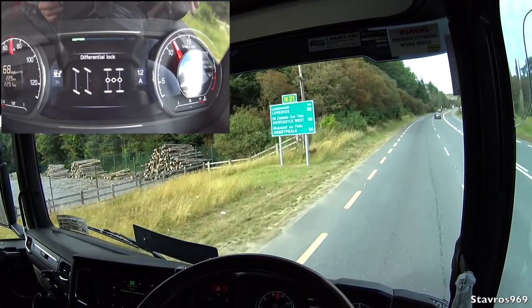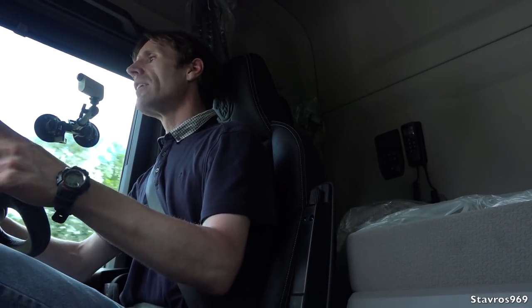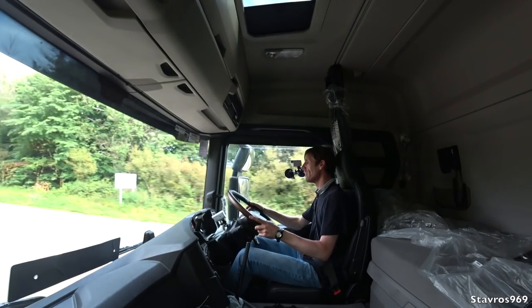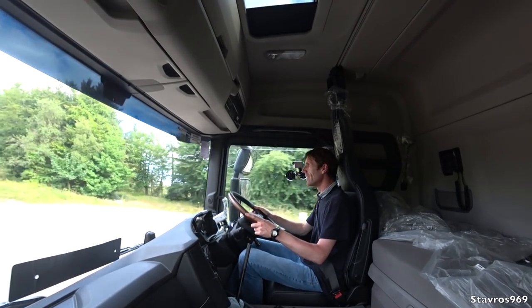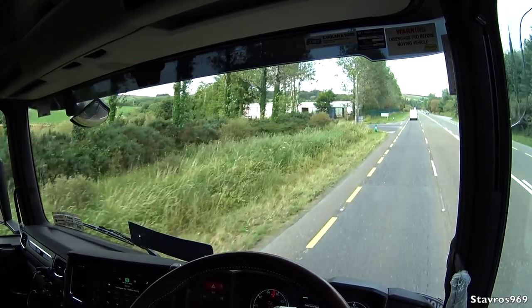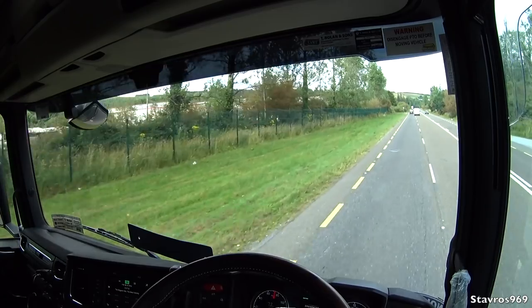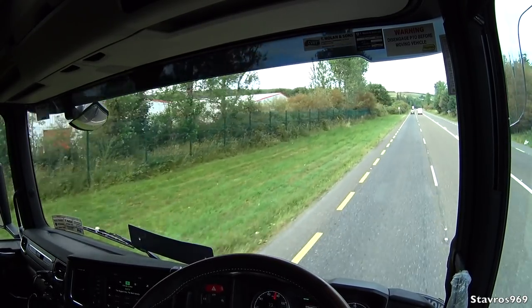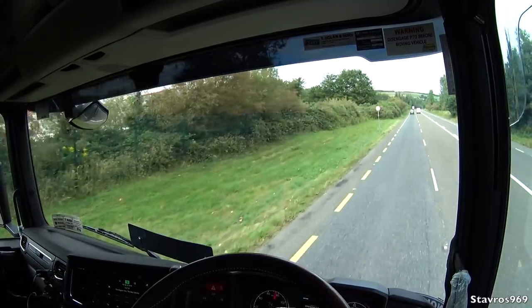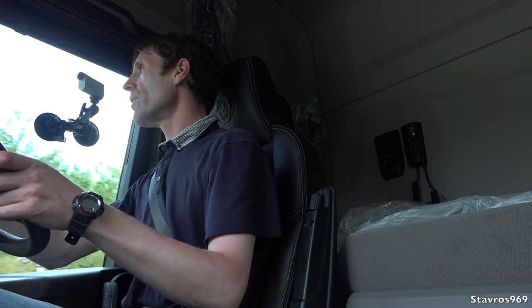Now I do have manual control. I can manual down through my gearbox, press in the clutch, go down through my gears manually if I want, or else manually with the gear selector, just up. And then we have a button at the side that we can press to have manual control. Now I also have two more switches on the gear selector, as I said, for when you're slowing down, you press your brakes and your auxiliary brake will come on automatically. So just one dab of the brake pedal and your auxiliary brake is automatically on.